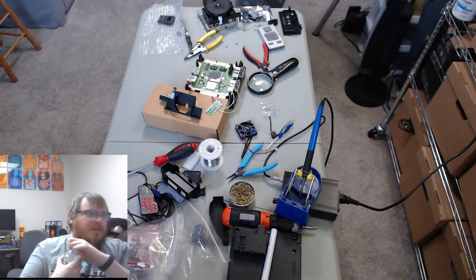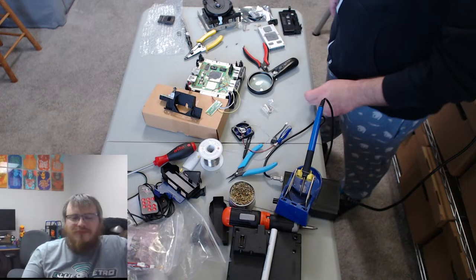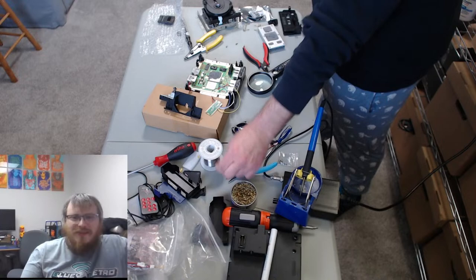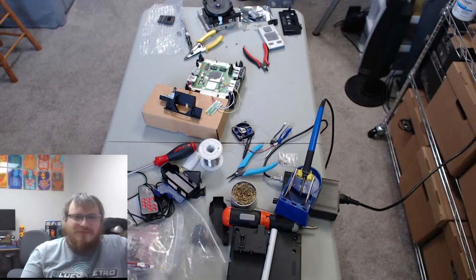And it's not just like, oh no, I modded something and maybe I broke it. I'm working on stuff where people are depending on me to come up with the results. And I put it together and I'm like, nothing happened. Like, what do you mean nothing happened? Double check everything. And I pull all the components out, and I put a 75K resistor where a 75 ohm would have gone. So by no means should you feel silly about that. That happens to all of us, and holy crap, it sucks sometimes.